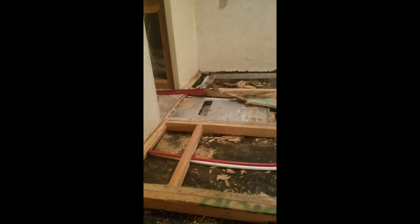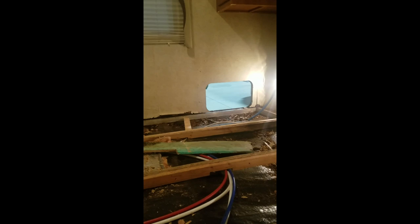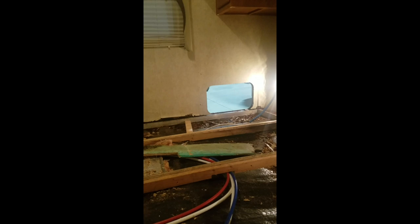And then we're having an issue from where it started to sag down on the wet plywood in the far corner right in here. All the way right here, it won't allow the 3/4 inch. It's sagged down on the wet wood. So what we're going to do is cut some dead men to sit up in here in the door jamb. Put a dead man up in here, up on the solid frame, because it's an aluminum framed wall. Then we're going to go down to the floor and use the jack and the weight of the camper to kind of lift the wall back up enough to slide the board under the wall edge. That way we'll get it true.